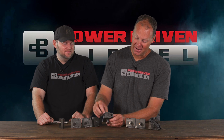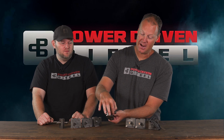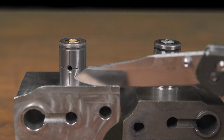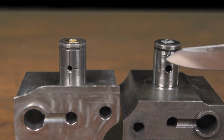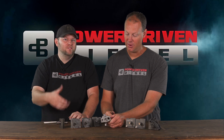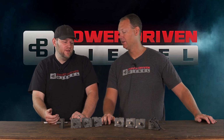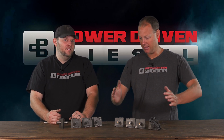But we actually have the groove around here like the factory. We've also added this groove right here. And that lets the oil really spread out across the whole entire bushing that's in your rocker arm. So it creates what they call that hydrodynamic wedge of oil under the rocker arm where that heavy loading is, where it's pushing up. So that's where everything happens on the underside.